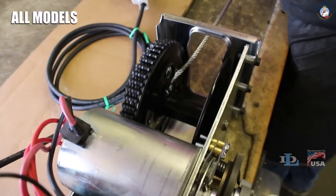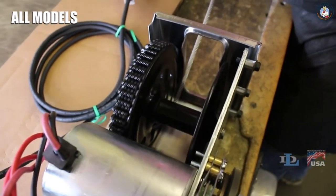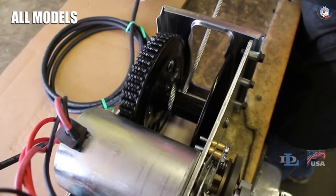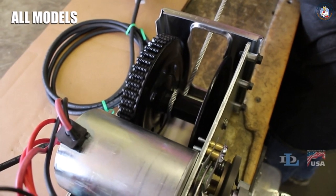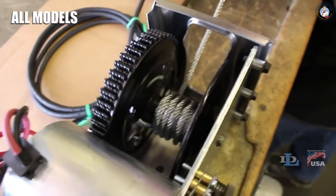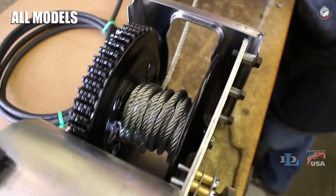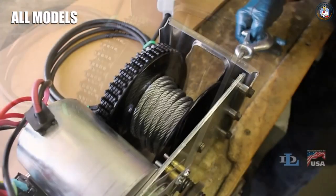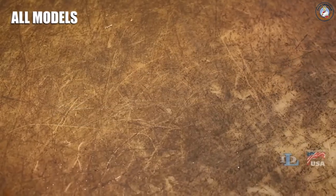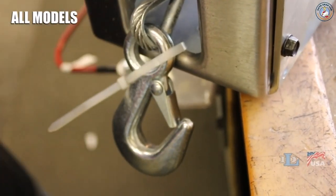Now it is time to install the new cable onto your winch. Remember, you should have just finished reinstalling the winch's cover. We're currently showing a coverless winch just so you can visually see how the cable should look as it's being wound. Connect your winch to power and turn it on to begin winding the new cable. This is a slow process, but be sure to firmly hold and pull back on the cable the entire time to help ensure that it winds onto the reel in even layers. Once you've wound the entire length of the cable, get a standard zip tie and use it to fasten the cable's hook to the bottom of the winch's base to finish the cable replacement process.